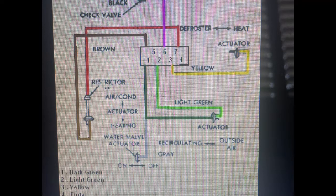This is the schematic I found online. There are a couple others but this one works for my particular vehicle, the second-gen Ram or Ramcharger. The only difference is there's no violet line — the black line is the one that comes in from the vacuum supply, and the red line is actually a lighter brown now. All the rest are the same, so you can go off this schematic. Pay attention to number four, which is the red hose that gets blocked off — that's your reference for all the numbers.